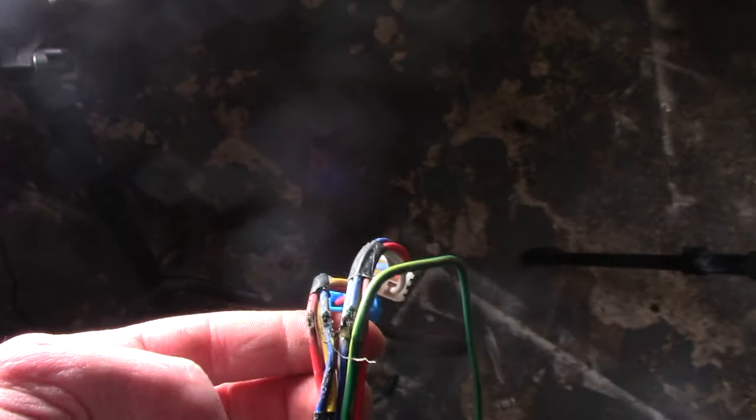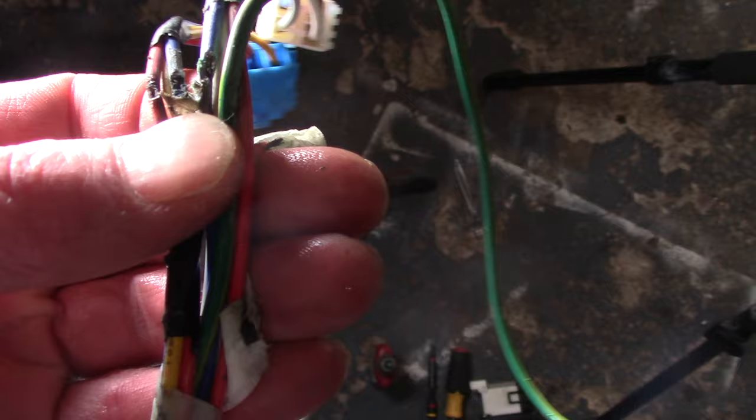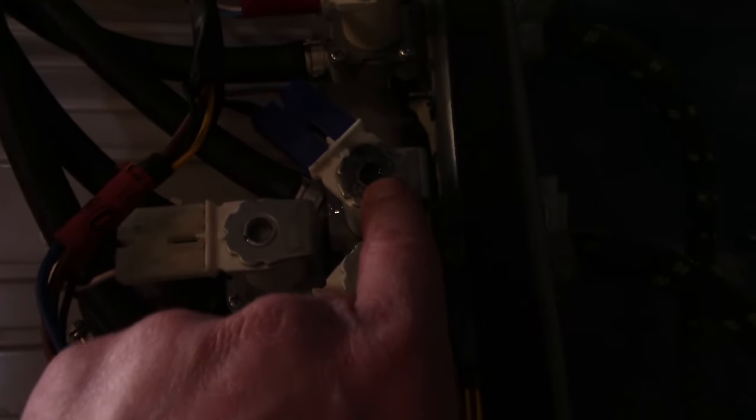In this case, the motor harness actually got burnt up. I noticed green corrosion on the jacketing, which doesn't happen often with LG machines. Looking further, I found the cold water valve was leaking ever so slightly — just enough to drip down onto the harness over time, causing corrosion and ultimately breaking it. In addition to the harness and hall sensor, I'll replace the cold water valve as well, and this washer should be good for another 10 to 15 years. Thanks for watching.